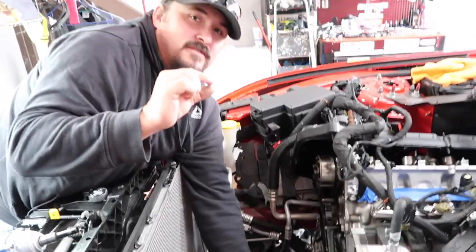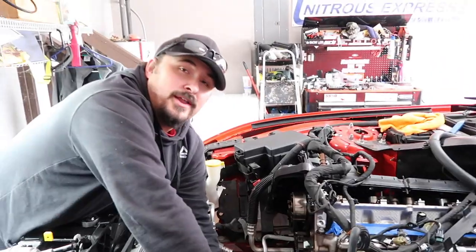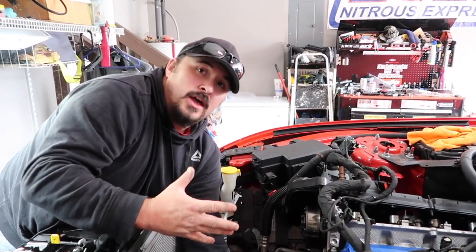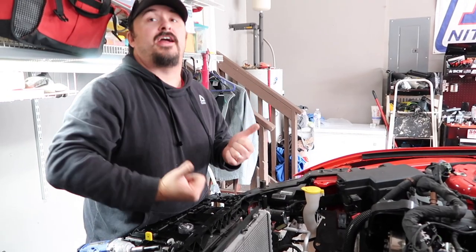You can take the spark plugs out. I was just going to say, do you have plugs in there? Easier. I can take them out real quick. You're going to change them out anyway, correct? Yeah. So we can take them out. Okay, let's do it. It makes it a lot easier because right now, when you're on the compression stroke, yep, and you're fighting the motor with the spark plugs in. With them out, you're not fighting that. The air can come out.